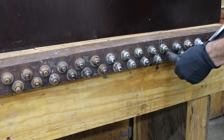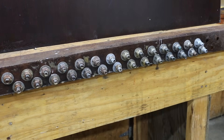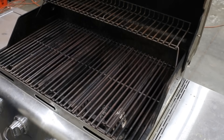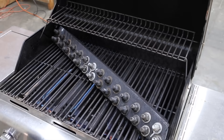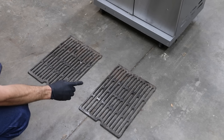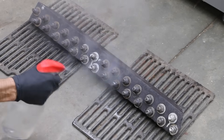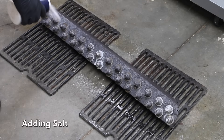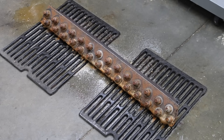I'm going to torque each one of these to 90 foot-pounds. It's time to expose this test set to a whole lot of oxidation as well as heat. The ability of anti-seize products to handle heat is pretty important, so we're going to put our test set inside this grill and cook it for right at one hour. Looks like the steel inside should be around 550 degrees Fahrenheit. When engine parts or brake components get hot in the wintertime and come across salt brine, there's a lot of oxidation that occurs. In order to simulate that process, I'm going to take this hot steel out, set it on this piece of metal, and spray it down with the oxidizing agent and cool it down. Wow, that didn't take long — look at all that rust!